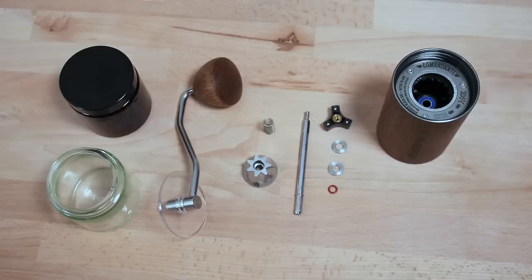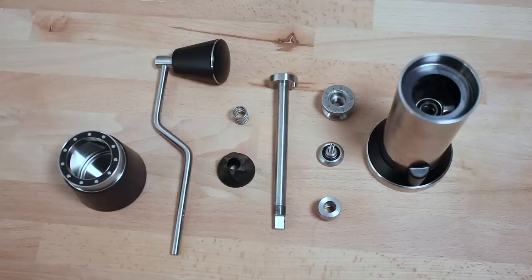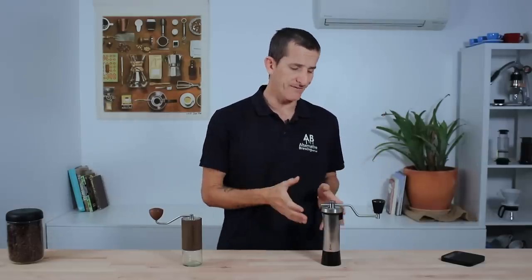Both grinders hold their settings really well, so after pulling them apart for cleaning and maintenance you can put them back together without losing any settings. The Comandante has a few more working parts when you pull it apart and you want to make sure you put them back the right way — there's plenty of help online for this. The Kinu however was a little more straightforward, easier to clean and put back together. Both use dual ball bearings within their axles and burr sets are fairly well aligned, though I believe the Kinu has a slight advantage in burr alignment. For daily brewing across multiple brew methods and occasional espresso, always tweaking and dialing in, I've chosen the Kinu Classic as my hand grinder.